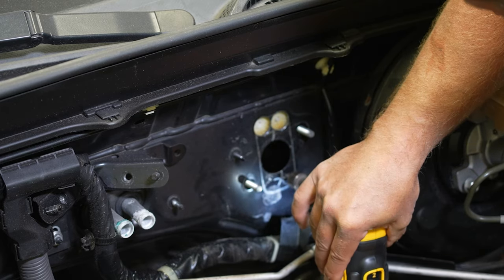Depending on which chassis you're doing this in, you might need to manipulate this and move it around. You can actually use this bracket elsewhere. If you wanted to, say, mount it on one of the bell housing bolt holes, you would just have to drill out this hole to be a little bit larger. But it was intended to go here, but it doesn't really matter. It could be used more universally, however you want to use it. And now we can tighten up the tab holding the line to this bracket.